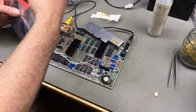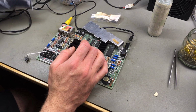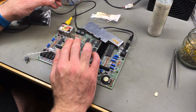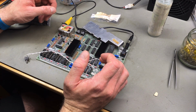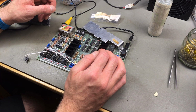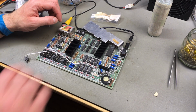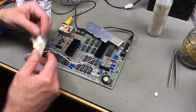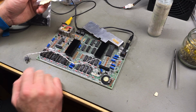The code is ICK40B. They are made for 40-pin dual inline package DIP ICs like these are. You can probably get these from various electronics resellers. I think I bought them from reichelt.de. I'm probably going to put a link in the description if I can find them. So that's what I'm going to do. Clean this up, and then use this heatsink plaster, which should be heat conductive glue basically, and apply them.